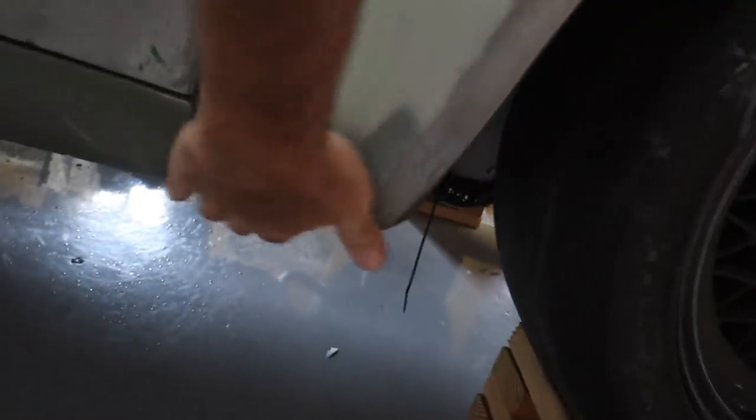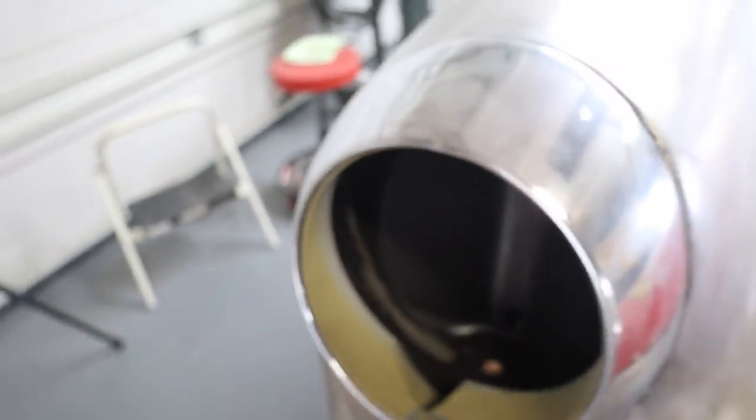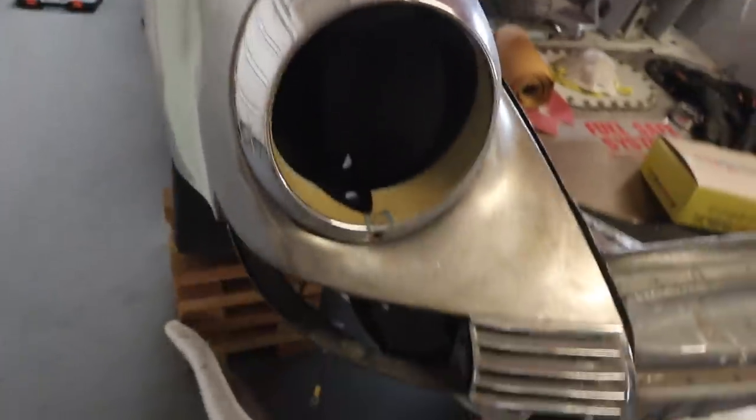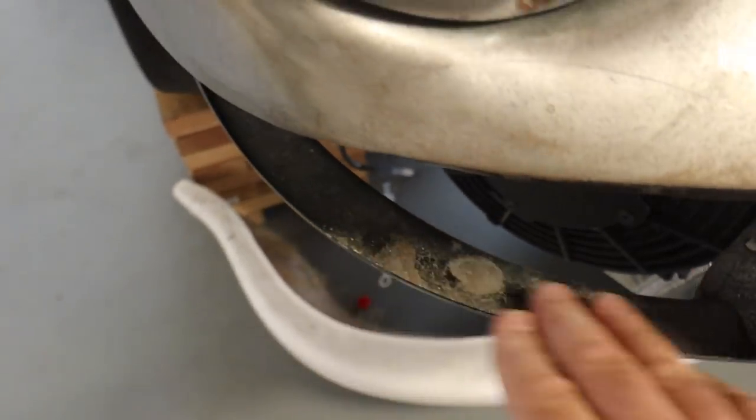There's just a little bit of body work stuff to do on each fender. On the inside, you can see where the paint has worn away and there's rust — that's from the paint stripper that dripped on the inside rail. What I'm going to do is sandblast that rust out, scuff the rest where I can, and try to get to nice bare metal.